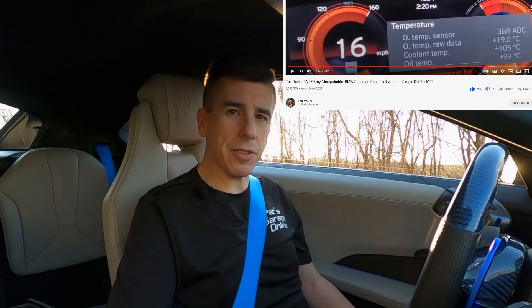In order to get to the service menu on the dash of the BMW i8, you've got to take the last five digits of your VIN, each individual digit, add them up, and that's the number you need to use to unlock the service menu. So my last five digits added up to 24. I'm going to walk through the process of displaying that coolant temperature information by unlocking the service menu.